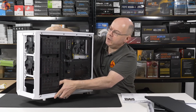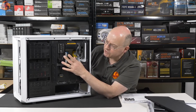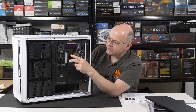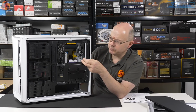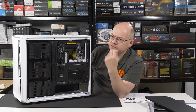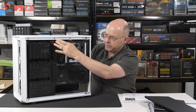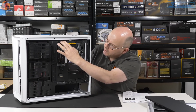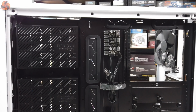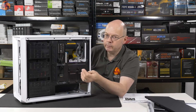We've got a PWM hub here on the back, and to my mind, that PWM hub kind of sums up this case in that we've seen this hub now from Fractal for, I think, 2 years off the top of my head, and whereas Phanteks has modified their hub and they've come up with a sort of strip which goes along the top here and takes up very little space, in this instance you'll note the hub is there and that EPS grommet is there. So if you're trailing your power supply cables up here, they will go directly over the PWM hub.